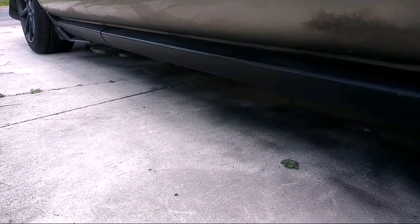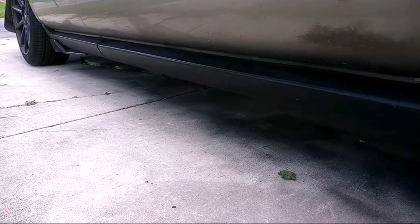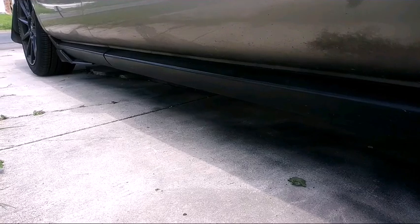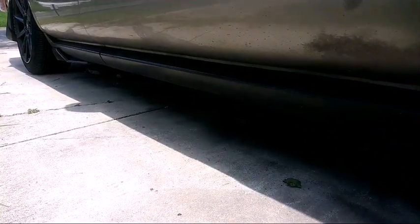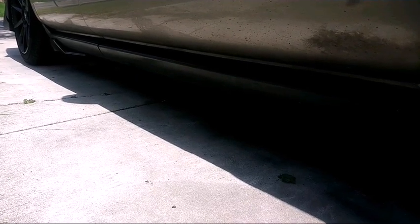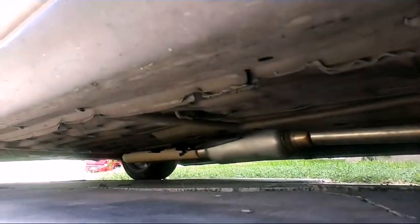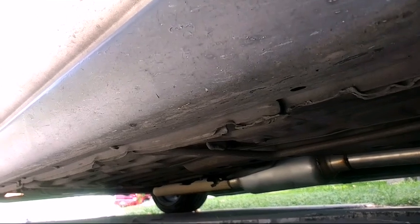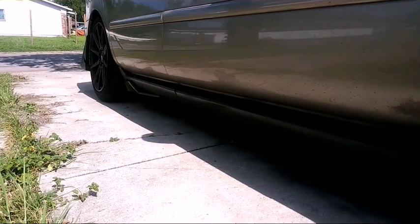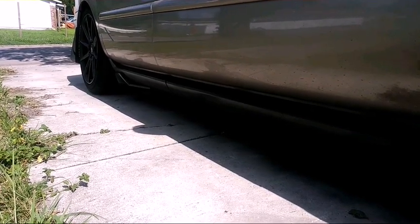Finally, number five — my favorite mod — the exhaust. I've been through about five exhaust systems and found it is hard to make this particular car sound decent without it sounding like a ricer, but I think I finally got it. You can replace the muffler in the stock location and maybe add a high-flow resonator, but I think this version is the best. I took it to a muffler shop and had them fabricate a whole new system — right after the catalytic converter I ran a bullet-style muffler, and it runs to the stock location at the back over the driver's side axle and out the back.